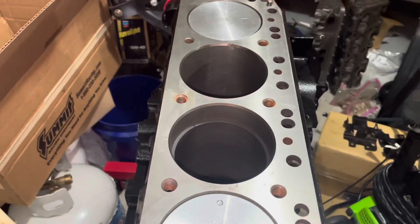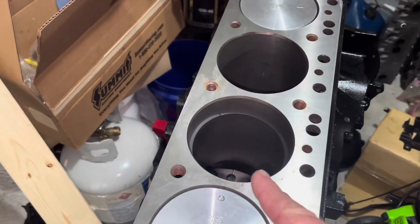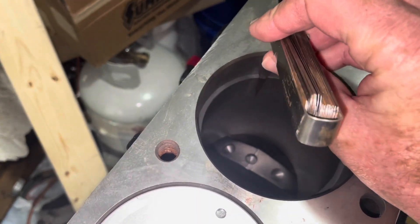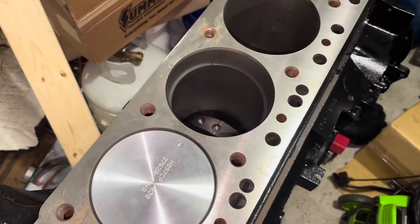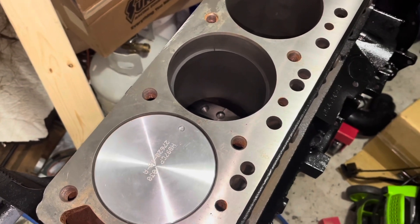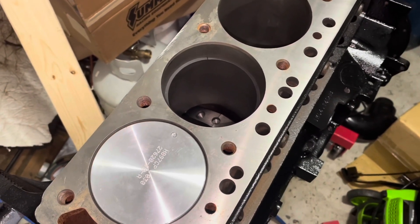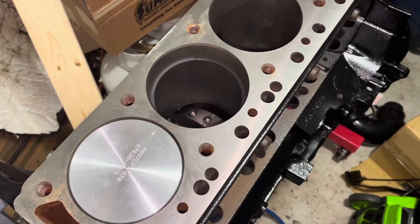Now I'm about to check the first ring groove gap. I've used the broken piston tool to push the top ring down inside the cylinder. I'm about to use the feeler gauge again — actually it's set to 0.017. The range in the factory manual is 0.010 to 0.020, but I like to use 0.004 times the bore as the general rule everybody uses. That's for normally aspirated engines. I'll find a chart and post a link in the description that gives you different ring gaps for different types of engines — whether it be nitrous, turbocharged, high performance, and so on. Those four-thousandths figures are for a stock engine.